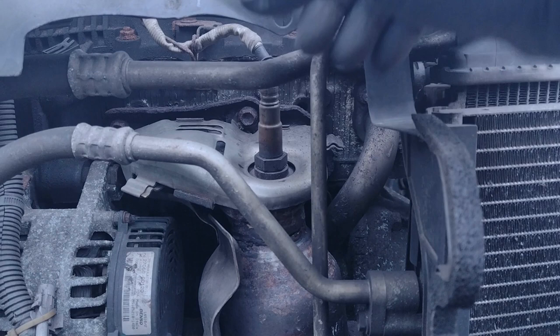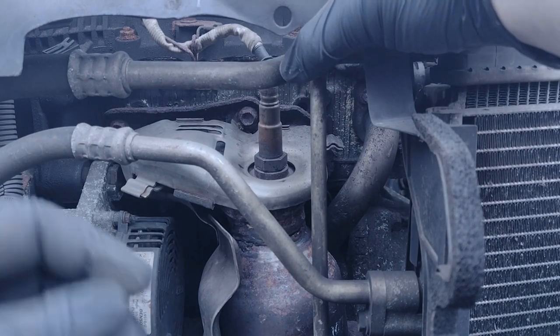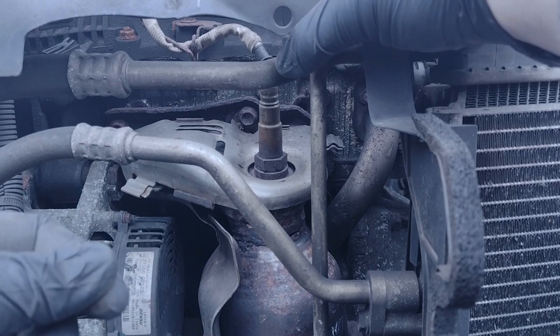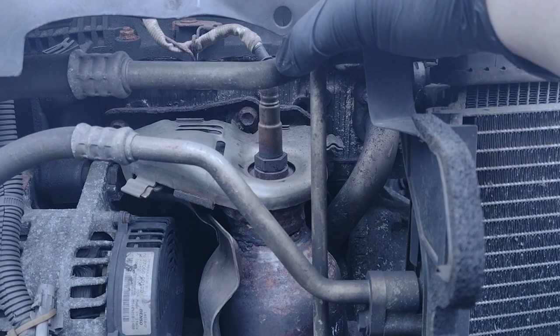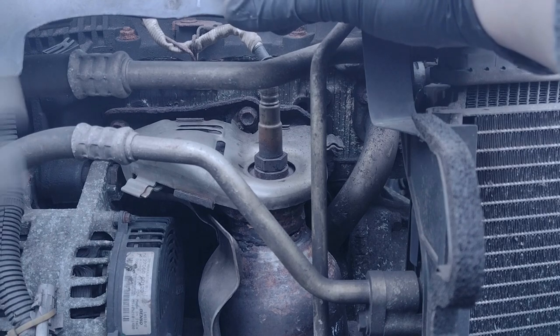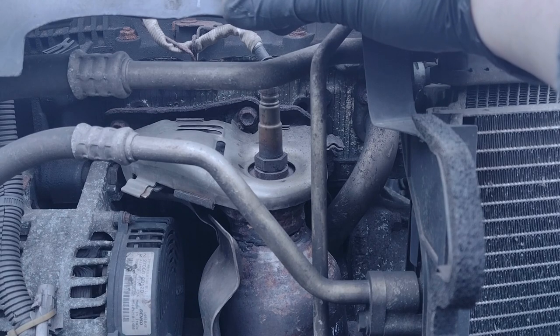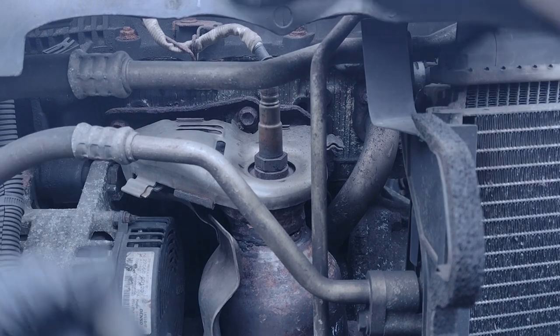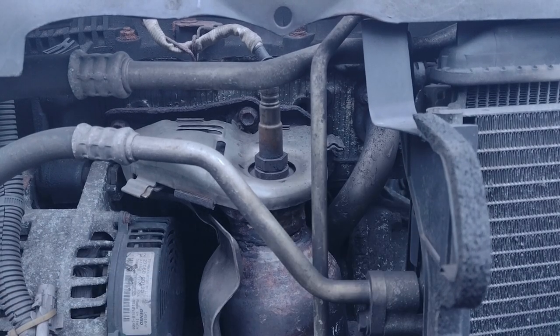Now, the way to get around that, obviously, is to put the air circulation on or off, so it doesn't bring air from the outside in, and job done. The problem is then, in the winter or on long journeys, if you're in the car, the windows get steamed up, and not in the good way. So I had to drive around with one of the windows at the back open, which is a pain. It's not too bad in the summer, but in the winter it's a pain in the proverbial.